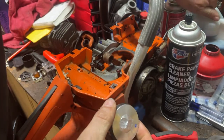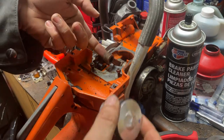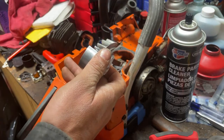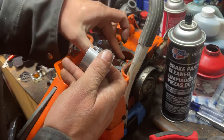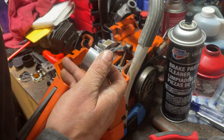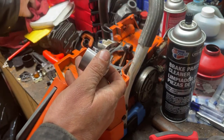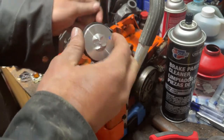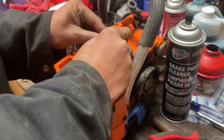I'm going to go ahead, oil up my finger, and drop oil down into the crankcase, put it in the wrist pin bearing. Try not to get it on any kind of sealing surface — put it on the rod bearing down there too. That way she starts out at least with a little bit of lubrication. As I said, this is a research and development thing — I'm just trying something to see whether or not it's even going to work and even feasible.